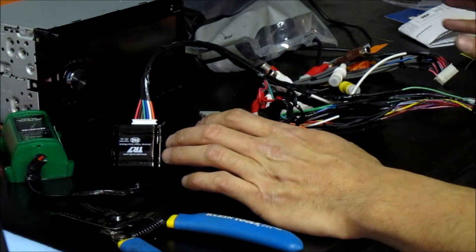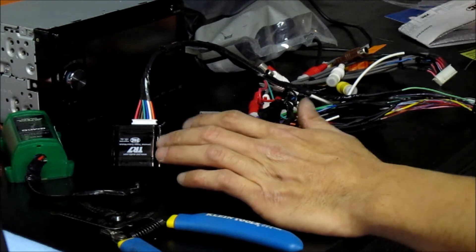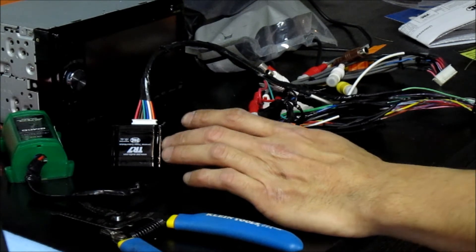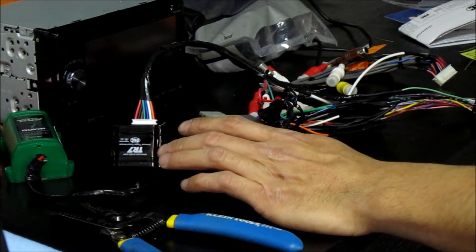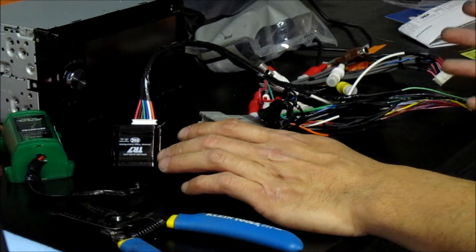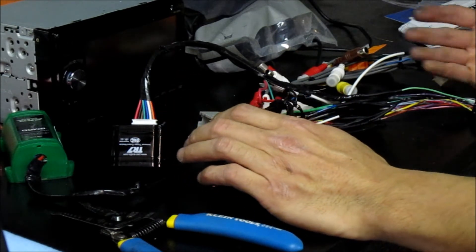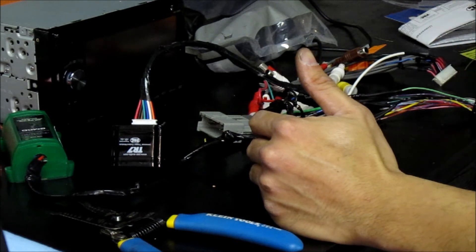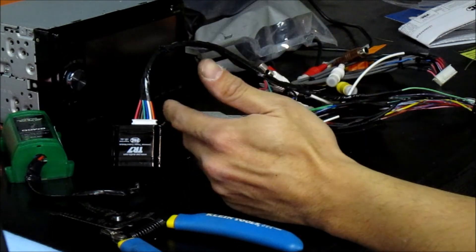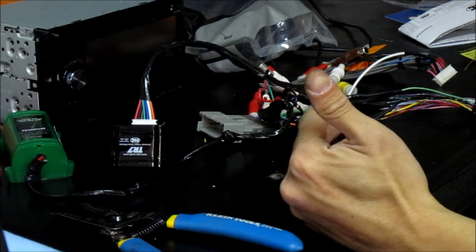A lot of you are probably wondering why I'm using a TR7 instead of just moving the wire over like on the F900 or other Pioneer navigation units — that trick works on the newer ones. On the F-Series though, there's a weird glitch that happens after about six months: you'll turn on the unit and it just reboots at the splash screen. After going on forums I found that it's because of the bypass locking up after a certain number of months. So I decided to use a TR7 to provide the proper signal and reset it every time — this should fix the problem. Message me in six months and ask how it's doing.